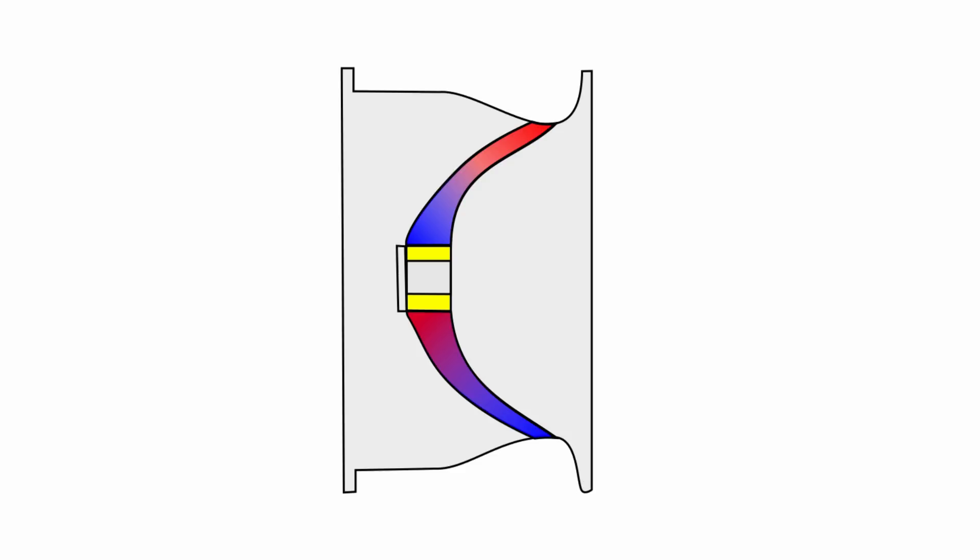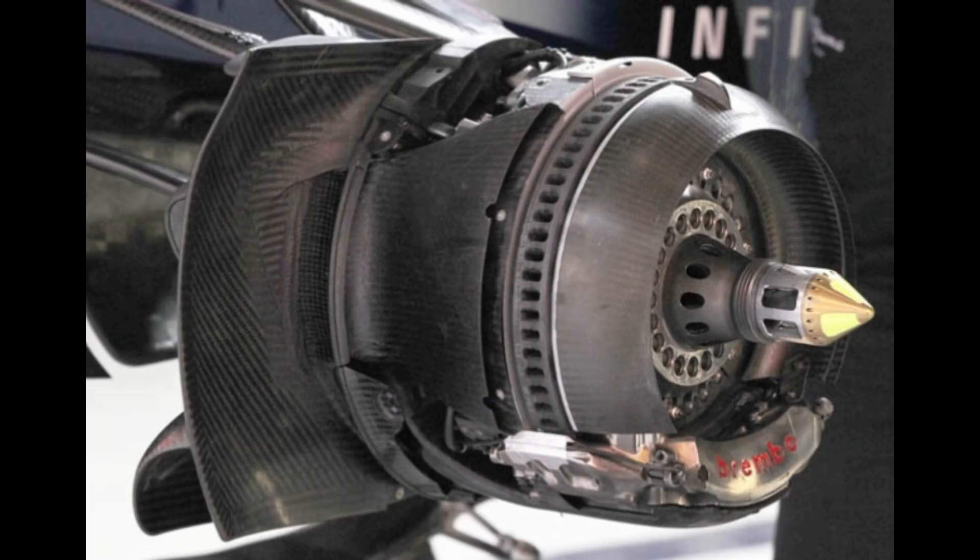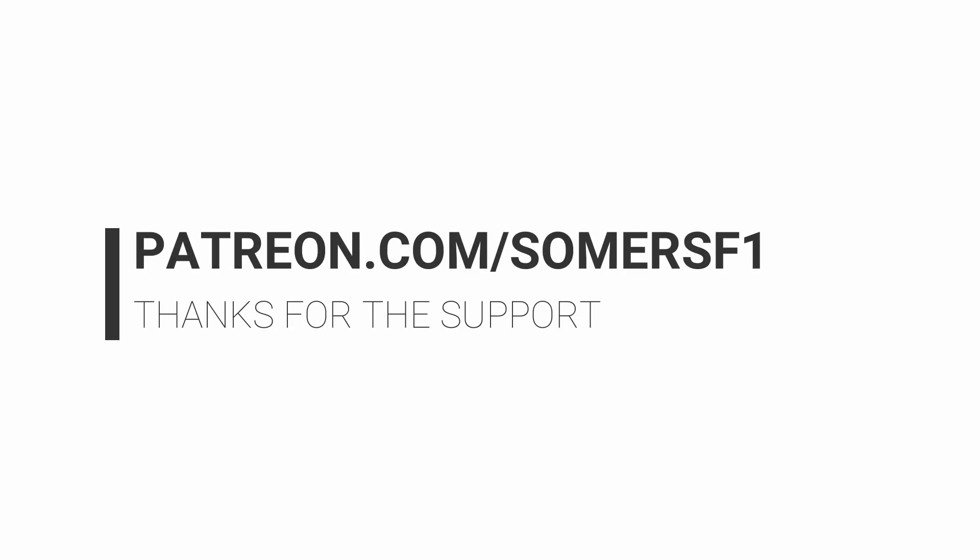This also means, at the inner end of the wheel, the gas will meet with the cylindrical chamber in the centre of the wheel, highlighted in yellow. And by means of thermal conductivity, they could exchange temperature values, with the resultant warmed or cooled air left to escape out the axle via the centre bore holes. This is my interpretation of the system based on numerous photographs that are available to me. And whilst I can see Ferrari's concern about how this could be used for aerodynamic gains, it would appear that any gain is lessened by the convoluted pathway of the airflow through the wheel's central hub, making it an entirely different prospect to the blown hub used and subsequently banned by Red Bull in 2012. Credit where credit's due to any of the photography included in this short video, and thanks to the patrons for their help in being able to get this kind of content out.